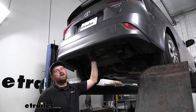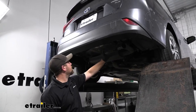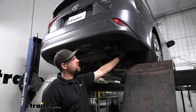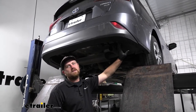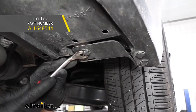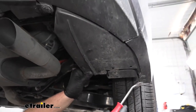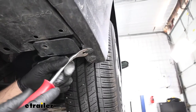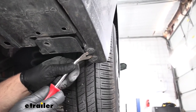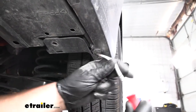To begin our installation, we're going to be working under the back of our Toyota here. The first thing we need to do is remove some of the panels — yours may be set up a little bit different. We're just going to start with the one here on the corner, and it's going to be held in place with several push pin type fasteners. The way these work, you take a trim tool or even a flathead screwdriver, and you're just going to pry underneath the head of the fastener. Then you're able to work the whole thing out. It's pretty tight — a lot of dirt and gunk gets built up in them and makes it kind of tricky to get out sometimes, but no big deal.